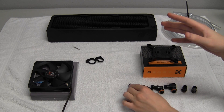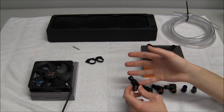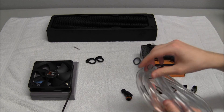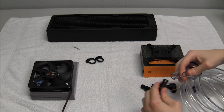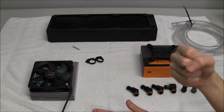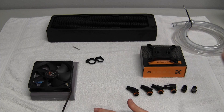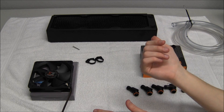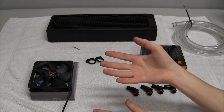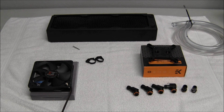One tip — though I don't recommend it for first-time water coolers — is to use slightly smaller tubing, like 3/8-inch tubing with a 1/2-inch barb. You warm up the end of the tubing, stretch it over the bigger nipple, and the tension holds it in place with no leaks, giving you a clampless design. It does work, but not recommended for beginners. Always flush out your radiator before using it, and make sure you test your loop. Thanks for watching — leave a comment, like, and subscribe, and look out for part two. This is Jesse from Jesse's Custom PCs.